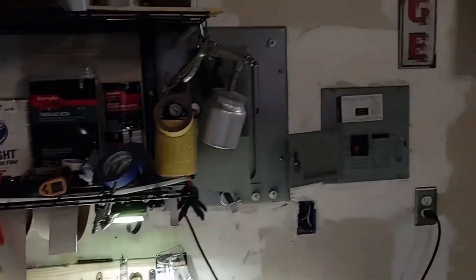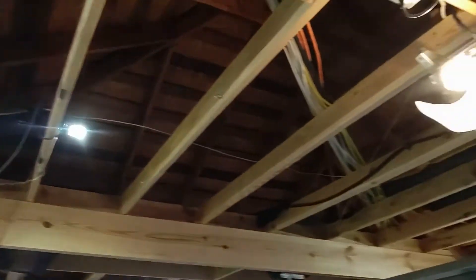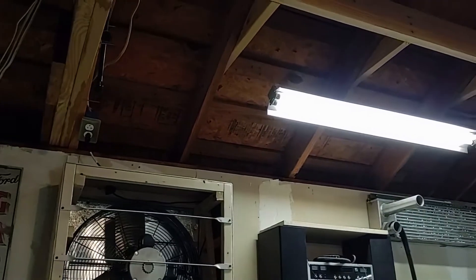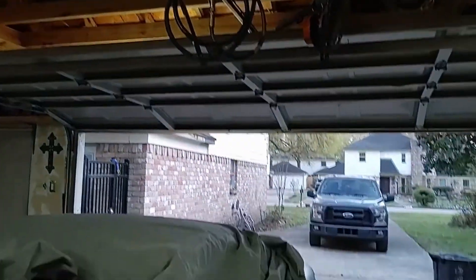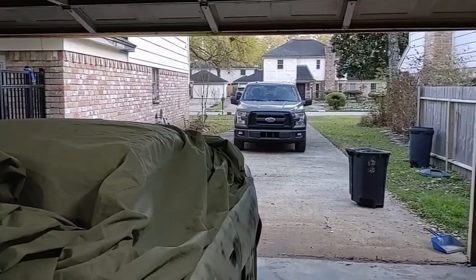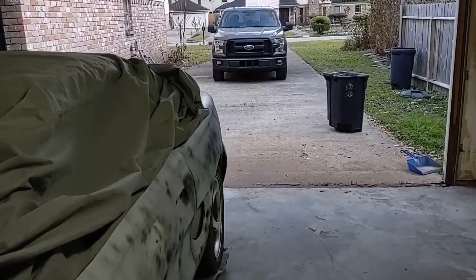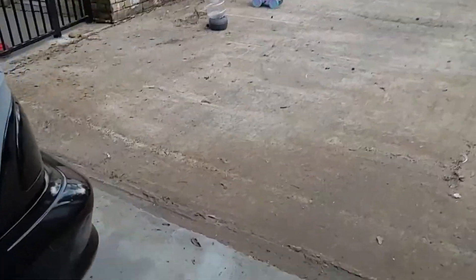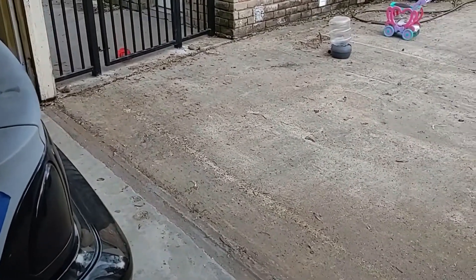Whenever it comes time to paint, I just fire this sucker up after I put up a bunch of sheeting. I'm gonna do a makeshift paint booth — put some plastic sheeting all up there, basically build a plastic box like Dexter. This fan is gonna suck out the bad air. I'm gonna leave the door cracked with a couple of filters and build a little enclosure so I can have the door cracked and just leave the filters right there, tape them to the plastic.